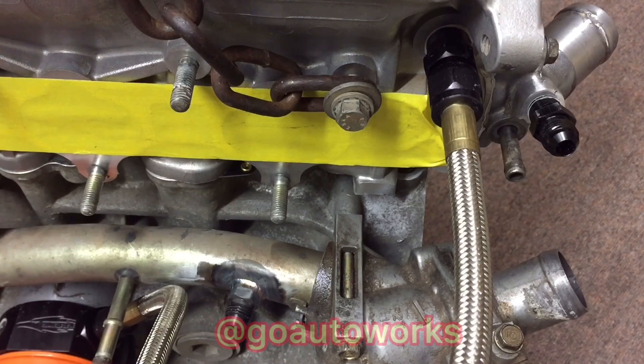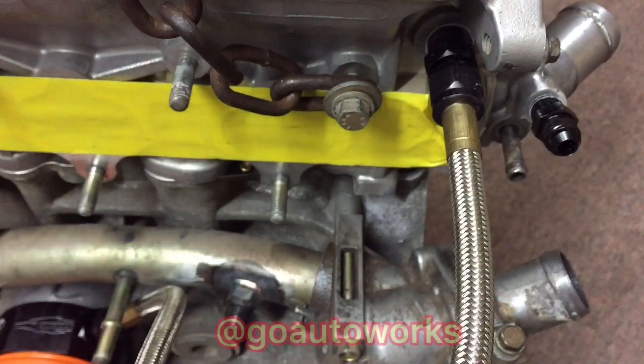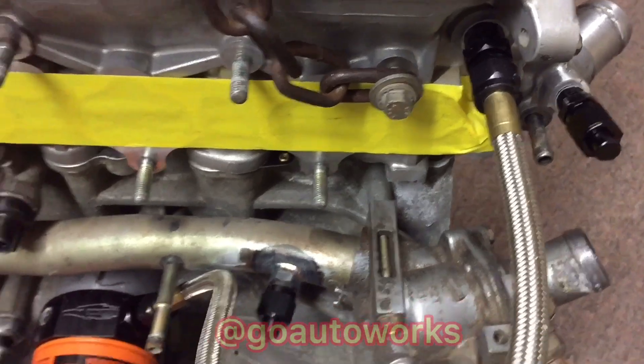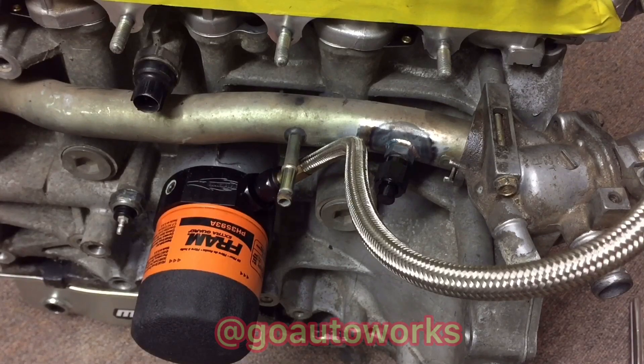Both pieces are ready to go. Since I'm not going to use the water lines from the get-go, I'm going to install vibrant flare caps to plug them both off so I don't have to worry about leaking. Next I'll install a pair of block breather fittings in the back, and it'll be good to go once we put the intake manifold back on — it's also getting the Golden Eagle intake manifold gasket. If you have any questions, let me know in the comments. If you want to see me assemble the water lines and how I route them, just leave a comment and I'll get back to it.